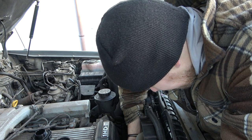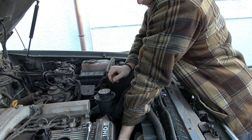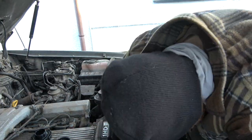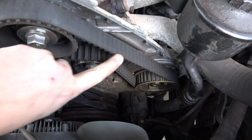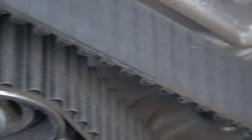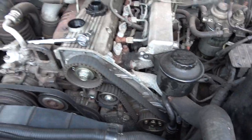These are a ten. It's quite tight to get to and it doesn't really help if you're left-handed. Well, I'm a bit surprised about this — because either this is not a 20-year-old belt or it is and it's in bloody good condition. Have a check at this. That's nothing. That's a little bit marked. But for 20 years old? I'm not convinced. But I'm going to replace it anyway because I'm here and I've got the belt. For literally 20 minutes — if that — to get that cover off. So simple.